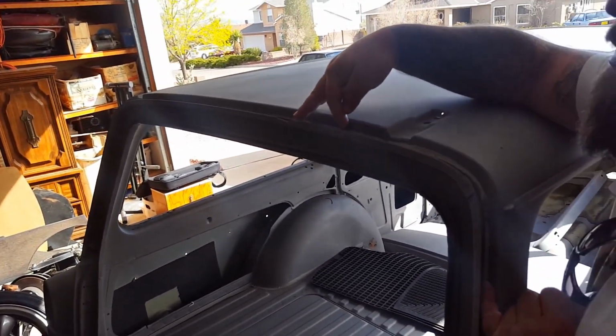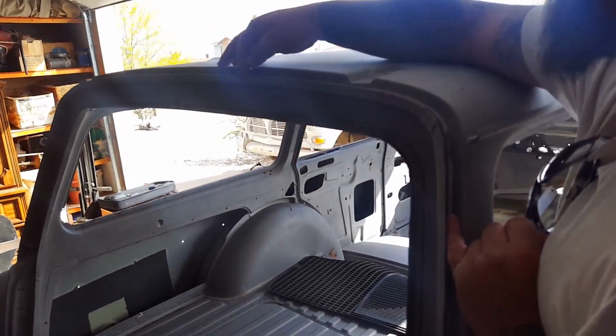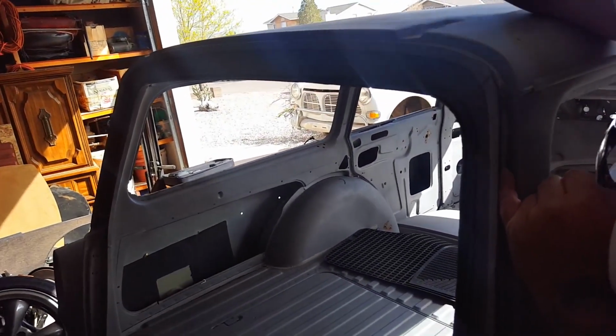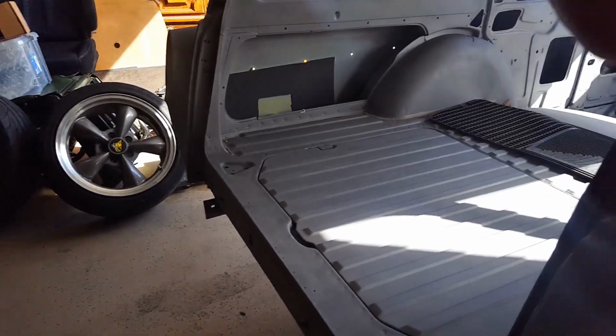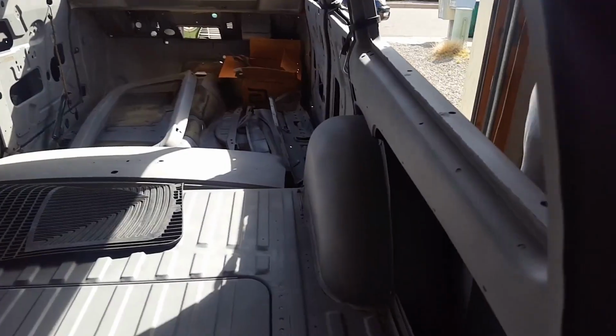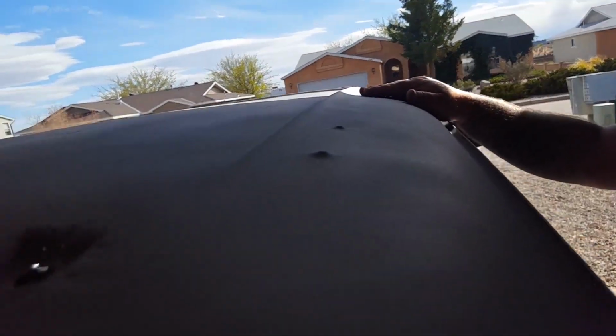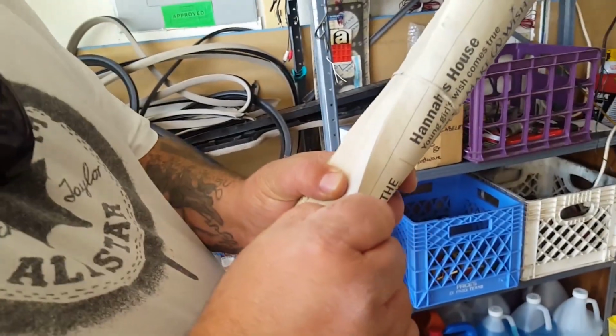This works bad there, and just replace that channel from there. Mm-hmm. Grind it down, bodywork it. You won't see none of the seams, even there. We're trying to avoid using Bondo if at all possible. Are you guys able to? Oh yeah. I mean, I understand just with the very top, it'll be just a skim. Yeah, but it's mostly this. It'll probably need a whole skim on this whole car. See that? And skim, we're talking no thicker than that, as thick as 2 papers.